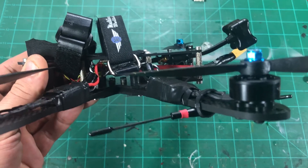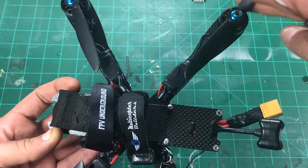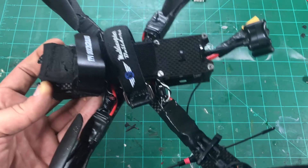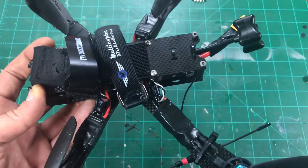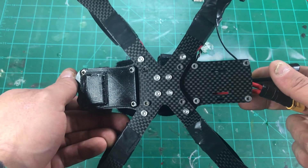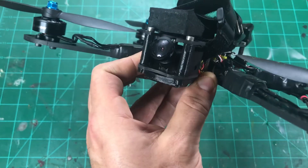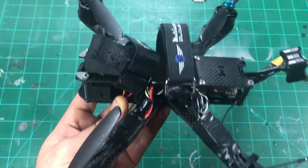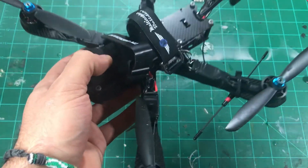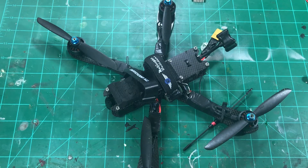The frame itself is pretty similar to a lot of what's out there — it's a low rider type deal, a stretch X. It'll probably fit six-and-a-half, maybe even seven-inch props if you wanted. It comes with really cool industrial-looking hardware, carbon with a nice pattern, inserted press-fitted nuts in the bottom so everything screws together well, some nice 3D printed parts, and a mount big enough inside for a RunCam Eagle 2.